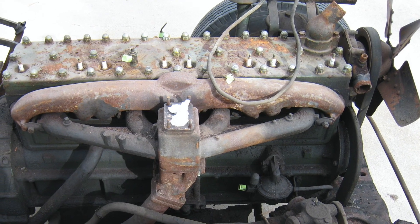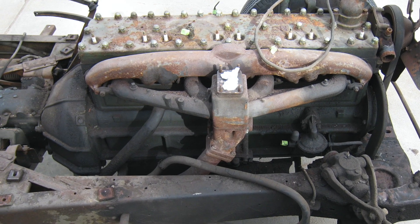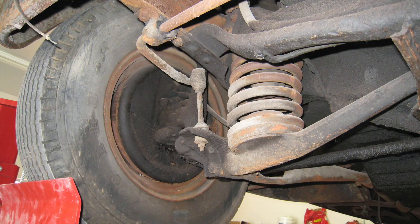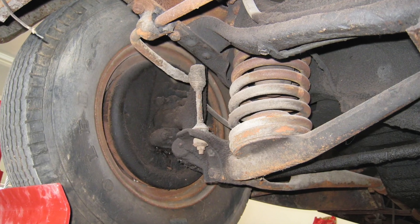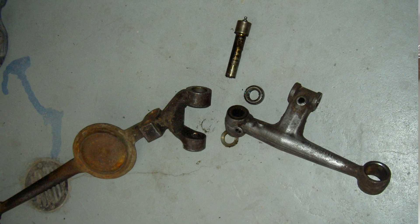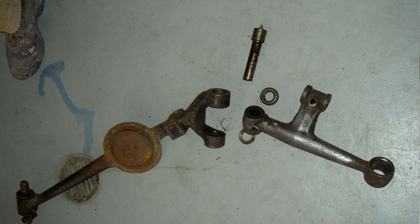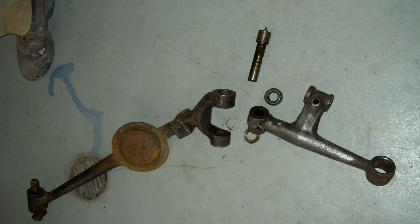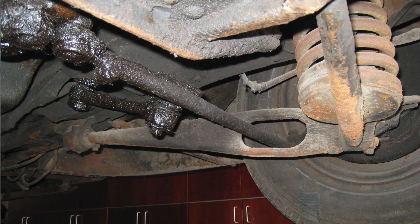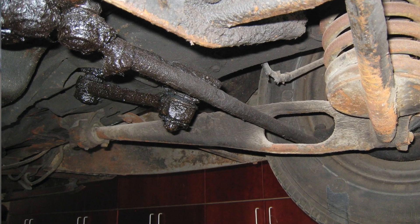The engine is mounted like typical Packard engines with a mount in the front — there's a bar going up and over in the front — and then it also has transmission mounts in the back and stabilizers in between. The front end is a Packard-owned design with coil springs, a kingpin member, and a trailing arm, which was introduced in 1935. In 1937 the senior cars adopted it, and they carried this same design right into the 1940-42 years and beyond, because it worked really well.